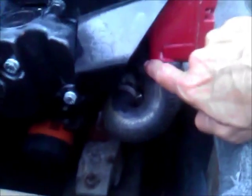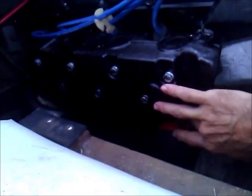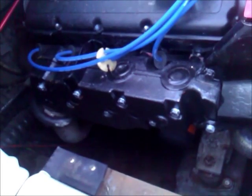It's so dark you can't see it, but there's a pipe that comes into this heat exchanger and goes back there — that's the pipe that would blow off. It was not going into the manifold and was actually leaking right here, trying to push this off. The pipe runs from the heat exchanger through a tube, goes to the back, through this thing, and back out the side. You have to take these bolts off — there's one underneath that's like a clip. It's real heavy, so it's easier to have two people do this. I had my wife help me start the bolts. That's basically the manifold reinstalled back on the engine.